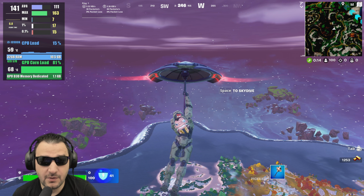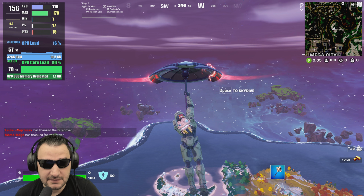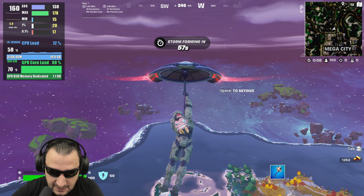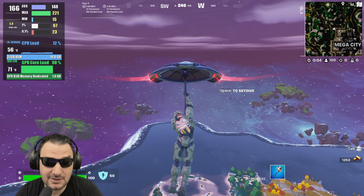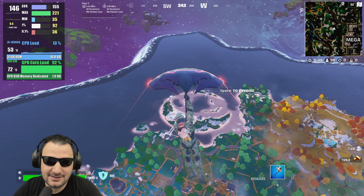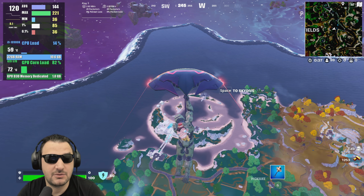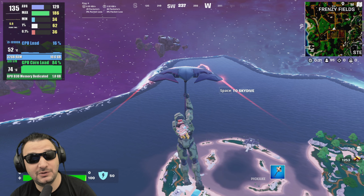So first things first, I want to point out that this model of the video card is from Point of View, and it's got a big radiator. It's got a big fan on that core. I didn't adjust anything on the fan, it's on 60%, and it's running 71 degrees. I wanted to see if that radiator is doing the job. On 60%, I think I have to increase the RPM on this fan and try to make it cool. But if it's staying on 72 degrees, it's okay. Fermi video cards are not known to be cool.